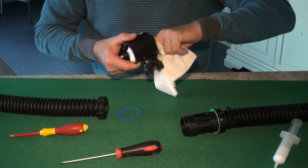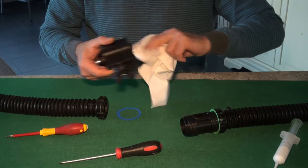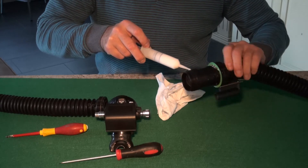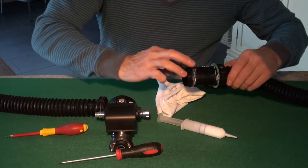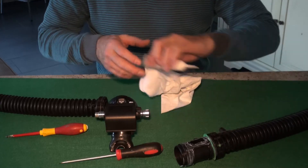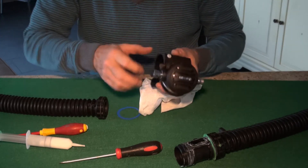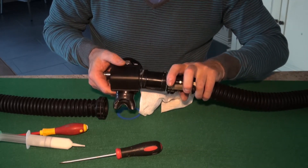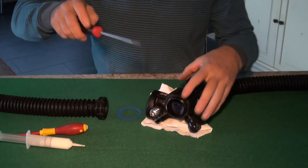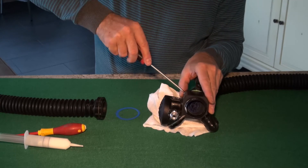Thoroughly clean the inner barrel and check for any major damage. Small scratches are obviously not going to affect performance. Now re-grease the inner barrel — don't be skimpy on the grease, as it's very important to the operation of the DSV. Smooth the grease all around evenly. Grease the outer barrel slightly as well — just enough for correct placement of the O-rings. Line up the retaining groove with the locking screw, then lock the inner barrel. Make sure the screw is approximately level.